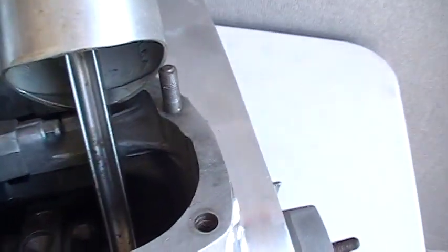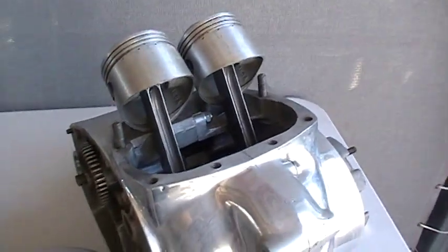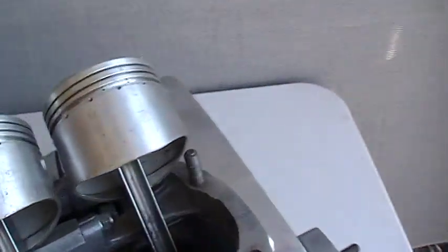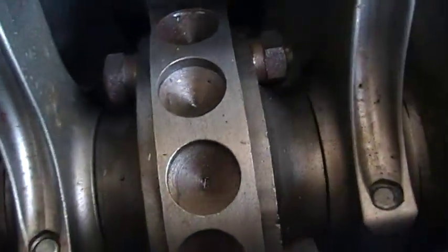And the Carrillo rods. What helped in the early stages when I started doing this, MAP hadn't started making these H-beam rods in chrome moly, so these ones have had to be drilled pretty well. As you can see, that one there's had a few drillings going on. It is a standard cast iron centre.